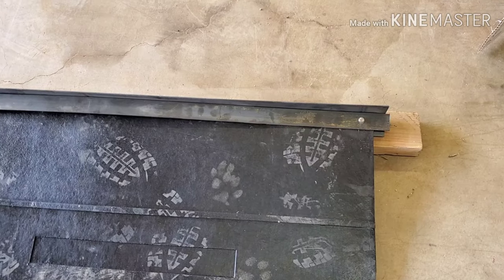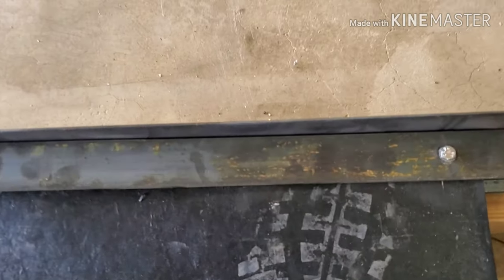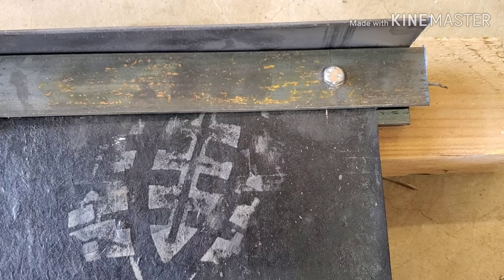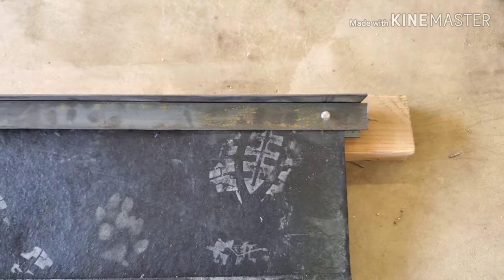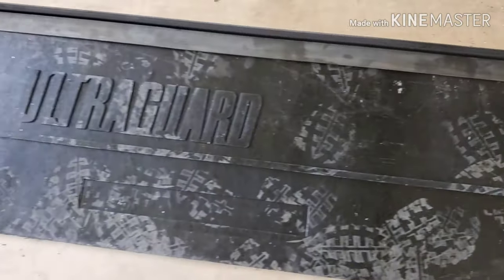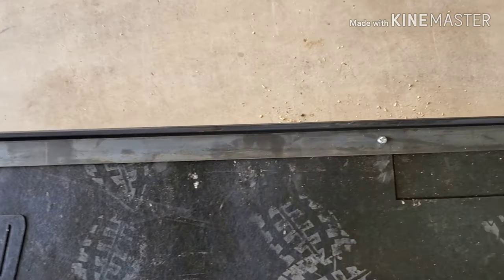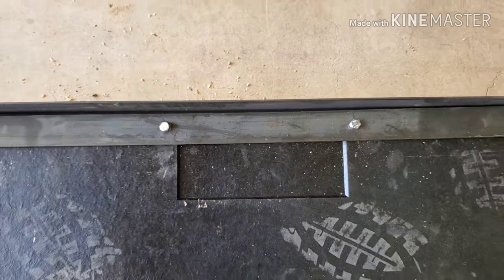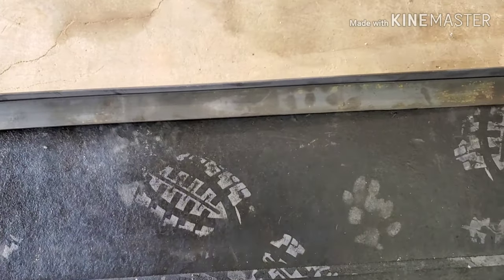What I've done here is marked all my holes on the iron and then started drilling. I put everything together, put it on a big piece of wood, and drilled right through all three pieces at the same time. I put that one bolt in to guide it, came back and did the one on the other end. What I actually should have done is gone from one end, then the two middle bolts, and worked my way out from there.